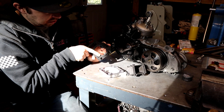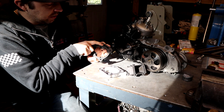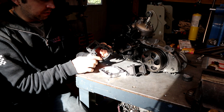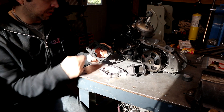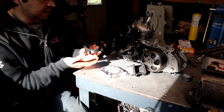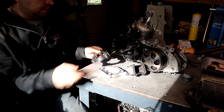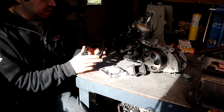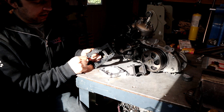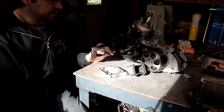Some of these curves aren't in the right position, so when you lay the rubber gasket it's not sitting where you want it — I believe this line needed to be moved up a hair. Also it just didn't really align properly. You can make it without that groove and just use a base gasket, and it works okay. It is nice having an o-ring so you can take the cylinder off and on many times without worrying about messing up your squish once set. Using this setup, you will have to cut out the old intake bridge, and then your intake opening is significantly larger — getting rid of a rather large restriction on the Honda motors.